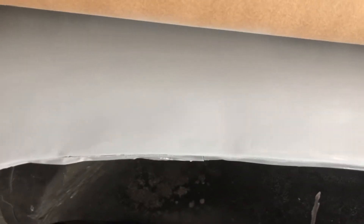Yeah, so it looks fairly decent. So it looks like I'm going to need to touch up some places again with the putty, and that's the joy of having the primer on — it's filler primer, and you can put the spot putty on top of it and sand it back down. You can see little places like this here, and little places like that, and all up here looks pretty doggone good, if I don't say so myself.